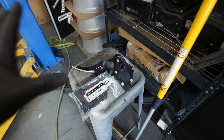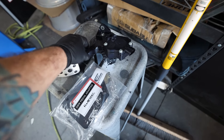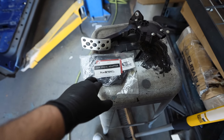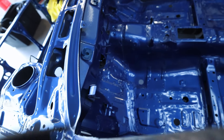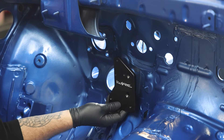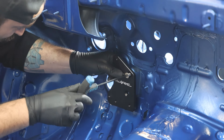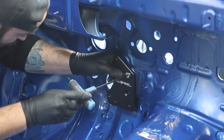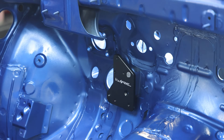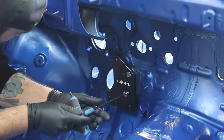What we're going to install next is our throttle pedal because it's another thing I just have sitting around. This is an iWire throttle pedal adapter for drive-by-wire throttle pedals. Now, this won't just bolt up — you have to use this adapter. I don't quite know where it's going to bolt yet, but it looks like this can really only go on one way, right here for the electronic throttle. The whole reason you'd want to do this conversion is if you're using a modern ECU that utilizes drive-by-wire — you're going to need this conversion plate because the drive-by-wire throttle pedal doesn't just bolt up.